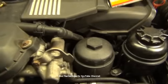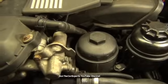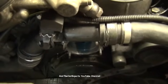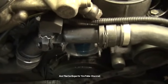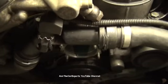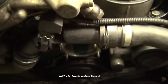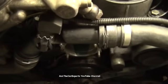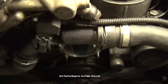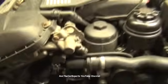That pipe actually can fill with a condensate. When the engine gets so hot, the coolant will actually break down and solidify into this thick substance that's almost like a plastic, looks like a gray material, and that can clog your heater core. And it can clog up that pipe. So even after repair, if a mechanic doesn't know to replace that pipe, you won't get any heat inside your cabin. That is actually a feed that feeds the water valve and provides the coolant for the heater core that runs along underneath that intake manifold.